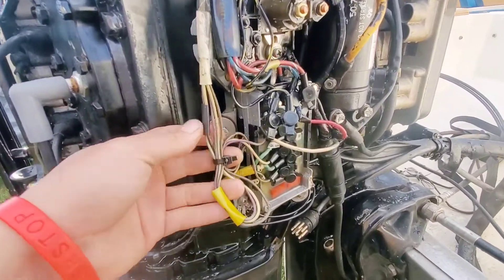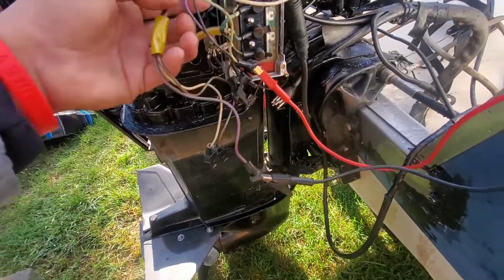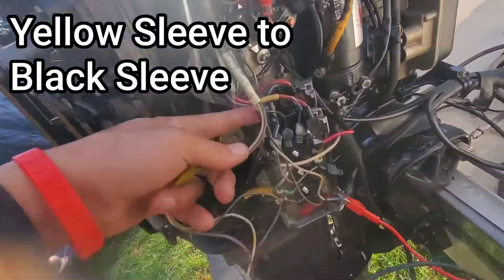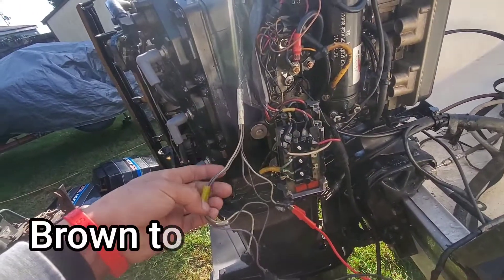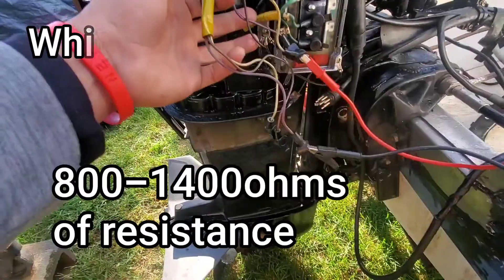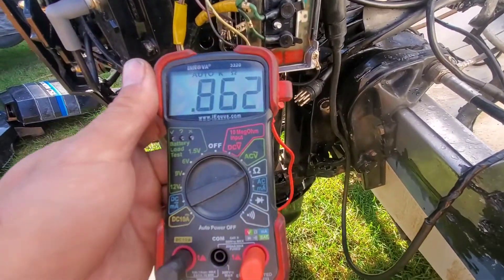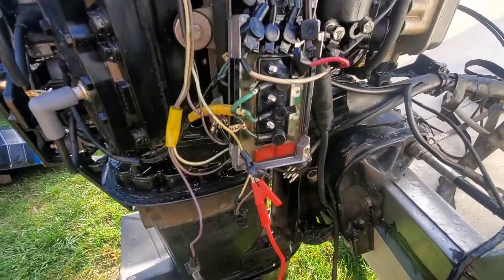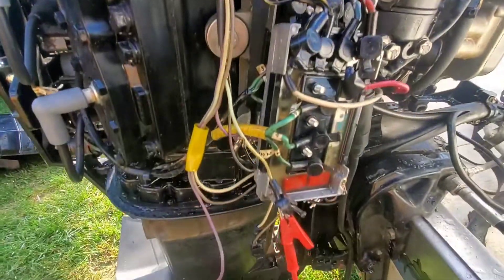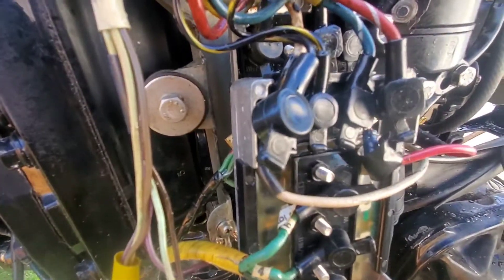Moving on — I'm going to test this trigger and just do a resistance test. So I've got to pull everything back out and disconnect everything again. I suspected the trigger is good. Anytime you measure this, you always go from the yellow sleeve to the black sleeve, then brown to purple, white to brown, purple to white. You're looking for around 800 to 1400 ohms of resistance. The middle wires — the white and brown ones — came in at 900 ohms. So the trigger is good. Now we're potentially looking at a faulty stator. I'm going to try to disconnect the bias wires and see if I can get a spark on one and four.